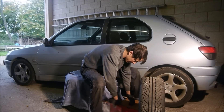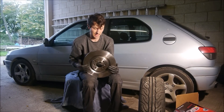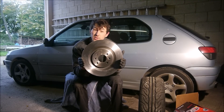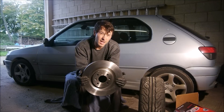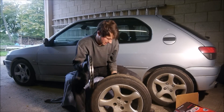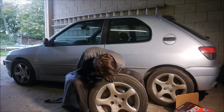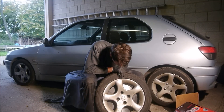Part of the reason I went for something different is this — a 326-millimetre disc. It's a DS3 Racing front disc, or the 208 GTI, but it's fitted directly to the 306 hub. I'll talk about calipers in the next video and these brakes properly. But for this video, it's the wheels. Now let me show you the problem. This is a Cyclone wheel, and that's the disc — there's no room for a caliper.